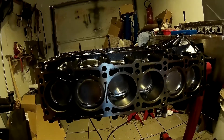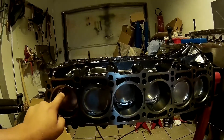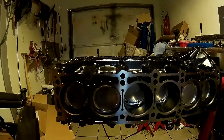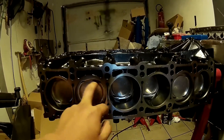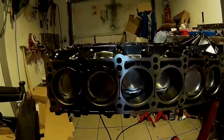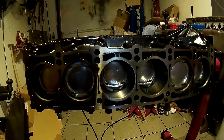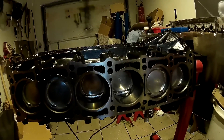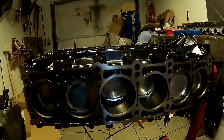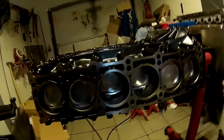I turned down the piston tops, so from an originally 1.2 millimeter deep dish it's now a 3.3 millimeter deep dish. From the piston top to piston bottom it remains 5.3 millimeters - I think it's somewhere around seven and a half millimeters thick to piston bottom standard. The compression ratio is now about 9 to 1, which is a little better for a boosted application.